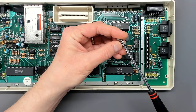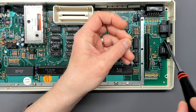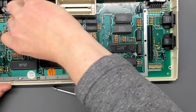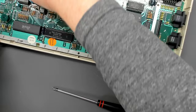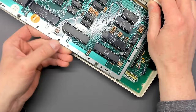There's a screw missing, so I'm going to drop screws into the little plastic tub on the desk. This screw looks like it's supposed to be on the other side of the SIO connector — it should have a little nut on the other side. Somebody has been in here and faffed about with screws in the wrong places. There's a brass thread grommet in the motherboard. Getting the motherboard out is quite difficult especially with the shield in the case — there's a strong chance of injury on the edges of the metal.